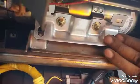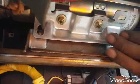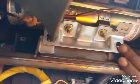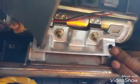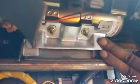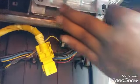After you type in the exact make and model of your vehicle and search for the airbag, it will give an exploded diagram view of the airbag and all of its components, and it will give you the exact part number for whatever part you may need. So again, that's Honda Overstock Parts or Acura Overstock Parts. I've learned that most of the part numbers are the same, but sometimes you have to go to each website to verify that. And then you can just call your local Honda dealer and you already have the part number. And I'm sure these little 10 millimeter bolts are probably about 75 cents to a dollar a piece. But we're going to see it releasing that one bolt. Getting that one bolt back up in there. We'll free this airbag.